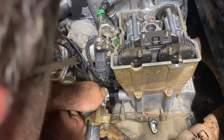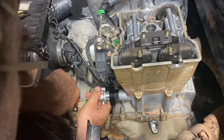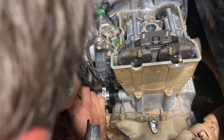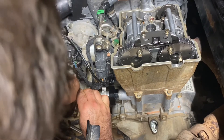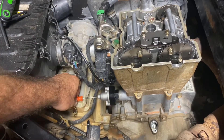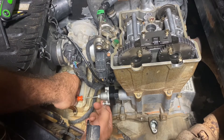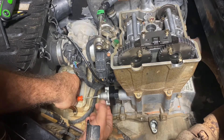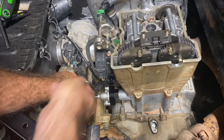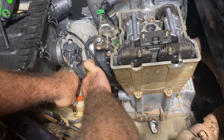You've got to kind of hold it all together and make sure it doesn't pop back. Okay, it's in now — I'm holding the screwdriver to keep the tension. Now you're going to install your two eight millimeter bolts. This is very important: do not let tension off until you have these bolts all the way in, because once the pressure is put on this there is no going back — you'd have to take it apart and redo it.